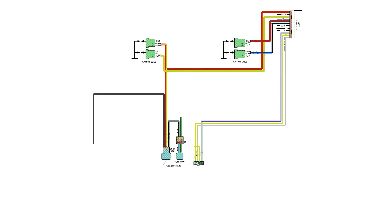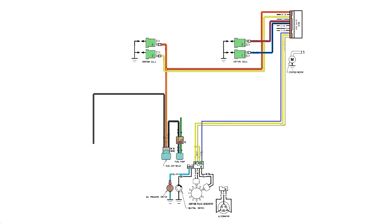This is the only part of the wire harness that we'll need. The remaining five wires on the connector will need to be cut about four inches long and spliced into the Magna harness. There are some more electrical items coming over as part of the VFR motor: the pulse generator, whose connector mates up directly; the starter motor, which is fed from the Magna harness; and the stator, which also connects directly to the existing Magna harness.